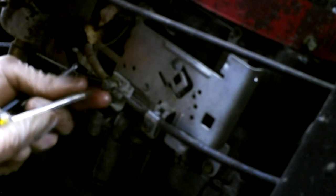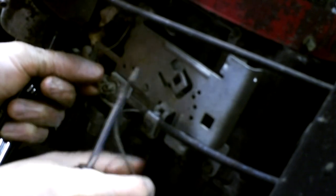A lot of people ask about the gas pedal setup and how it's bolted in, but it's basically nothing different than your normal setup. This is the through cable and it's just got a regular flathead here. What I did was I took the spring and looped it through the whole thing — in order to put the spring on, you have to actually pull the whole screw out. From there it drops out and the wire pulls out through, and that holds it in place so it can never come loose. There's the throttle assembly right there.